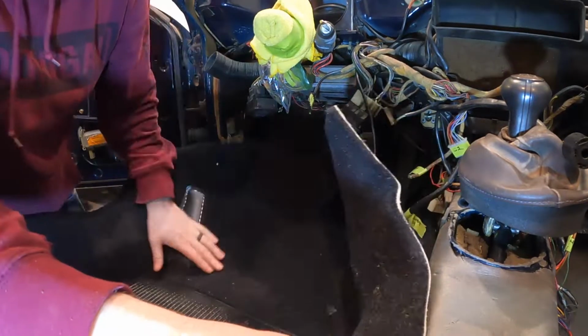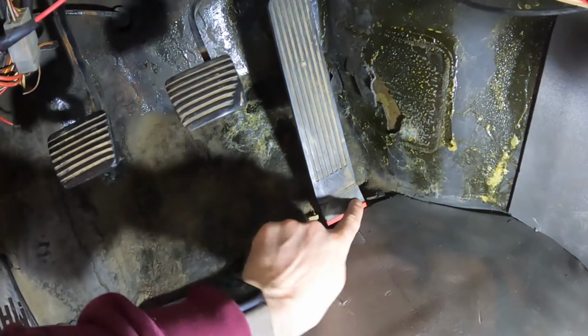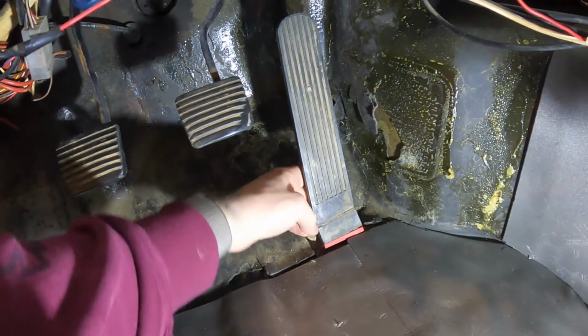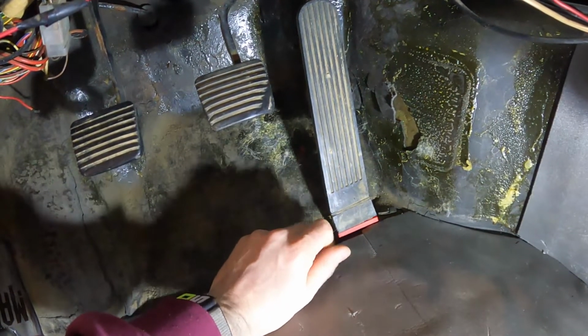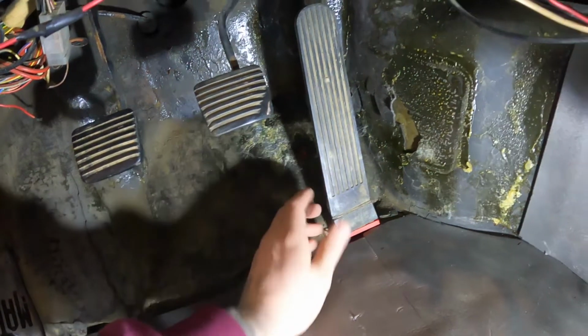Here's the carpet. It's nice and new. It has this heel pad here and a little bit of a worn area and a footrest. I need to slide it up in here and see right here where this gas pedal hinges. Well, I believe there's a couple bolts right here in the back. I'm gonna pop that off, see where the marking is, slide the carpet up in here, make the mark where it is, slice a little hole in there, and then bring it back on down.